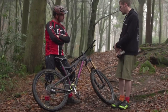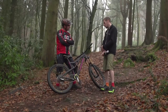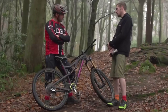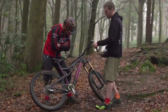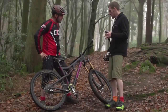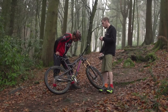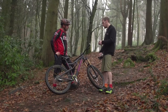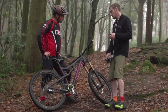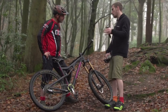The shock is set up slightly differently from the fork - we use techniques like sag for setup. But what we're really talking about is how far you want to go with your riding and how much you can adjust on the fly on the trail. A shock like this with a PPS and Fox has basic adjustment - rebound damping which makes the shock slower or faster, a trail or open setting, and then an on-the-fly three-position platform lever which you'd use when climbing up hills or on fire roads.